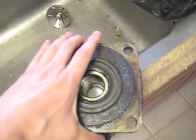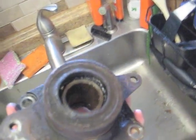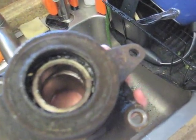And you're going to take those seals out with either a real big screwdriver or maybe even a tire iron. And then there's that spacer in there. You can move it to the side a little like that and knock those bearings out. That's going to destroy the bearings. That outer race right here comes out. There it goes. Anyway,